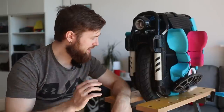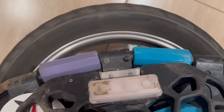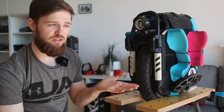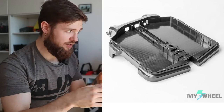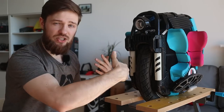Two more quality concerns: the rim, even in its third or fourth iteration, can still bend. Make sure to ride at least 35–45 PSI, especially if you're a heavier rider. I did quite a lot of jumps and crazy stuff, so my rim has a couple of bends. Also, the inner side of the shell where the L-hangers connect to the pedals is just plastic. If you ride on one leg, the shell will flex and the tire will scratch against it. I'd like to see a metal plate there for reinforcement, though it would add weight.